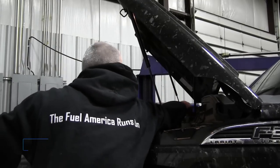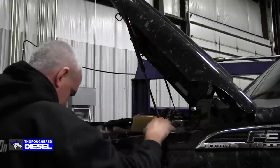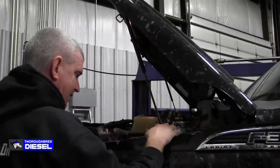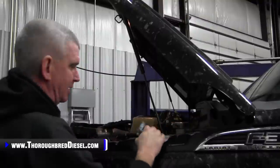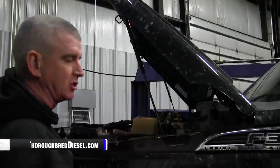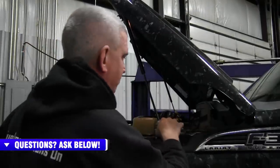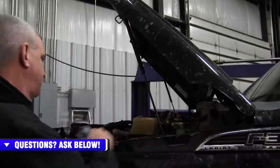When you drive it again, you just wanna make sure that you've got good shifts. First off, you want to make sure that you don't have any beating and banging. Just look for the obvious stuff, external leaks or anything like that. So we're gonna put a little bit more fluid in this. When we come back, we're gonna take you out on a test drive. We're gonna show you what line pressure the transmission is making now.